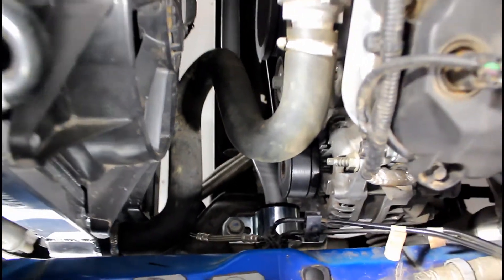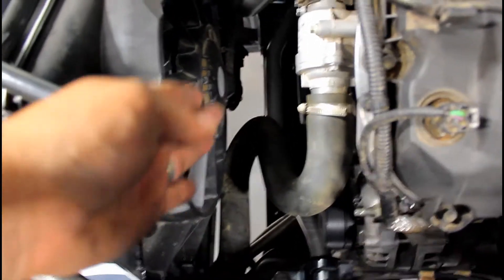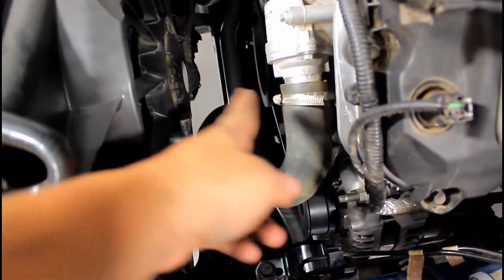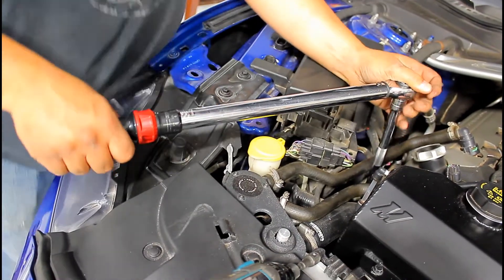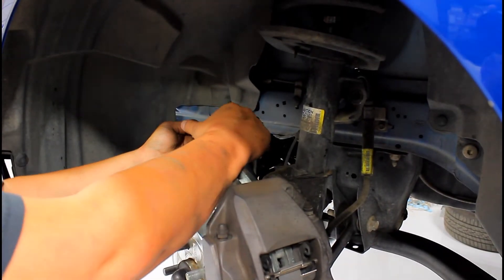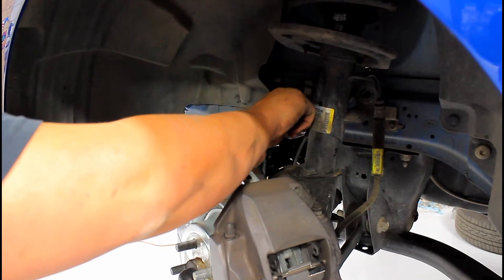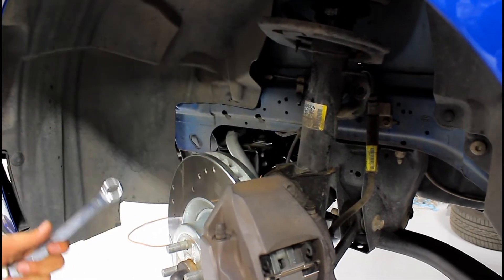I'm gonna be running turbos and want the engine bay more compact, so I'm gonna have my buddy push the sway bar as close to the engine as possible to give more clearance where the exhaust pipes are going to come from, then tighten them down from above. He's underneath pushing it and I'm tightening the four bolts. Then grab the torque wrench and torque them down to 90 foot-pounds. For the one you can't reach with a torque wrench, use the wrench-on-wrench trick.